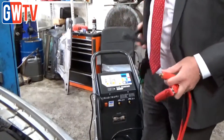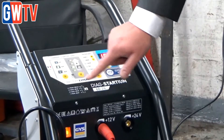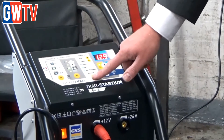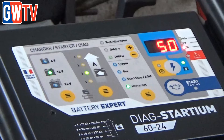The Volvo demo is a very good one because the battery is actually in the boot underneath another panel. They've got two charging points underneath the bonnet and we had no idea what type of battery — but the charger doesn't care. Put it into universal mode and it charges the battery safely. The guys loved it because it made their job a lot easier, as they don't have to identify the battery, which takes time.